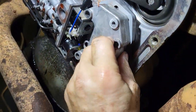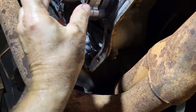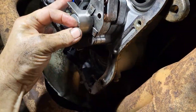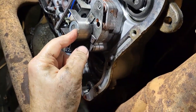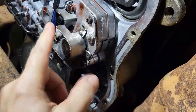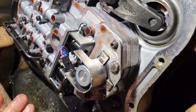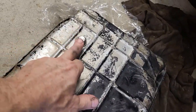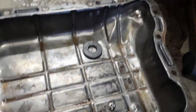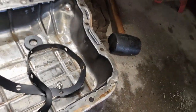Now we can button this thing up. I just have to get the bolts started. It's going to go right here, and then there's the plug that plugs into it. Let me get this all bolted up in there. Got this all in — now we just need to hook up our plug and bolt it in. We're pretty much ready at this point to put the filter on and put the pan back on. I've got the drain plug in there — right there. The magnet is in the pan, the pan's clean, we've got a gasket, and the filter's on. Let's get this up and wrap this up.